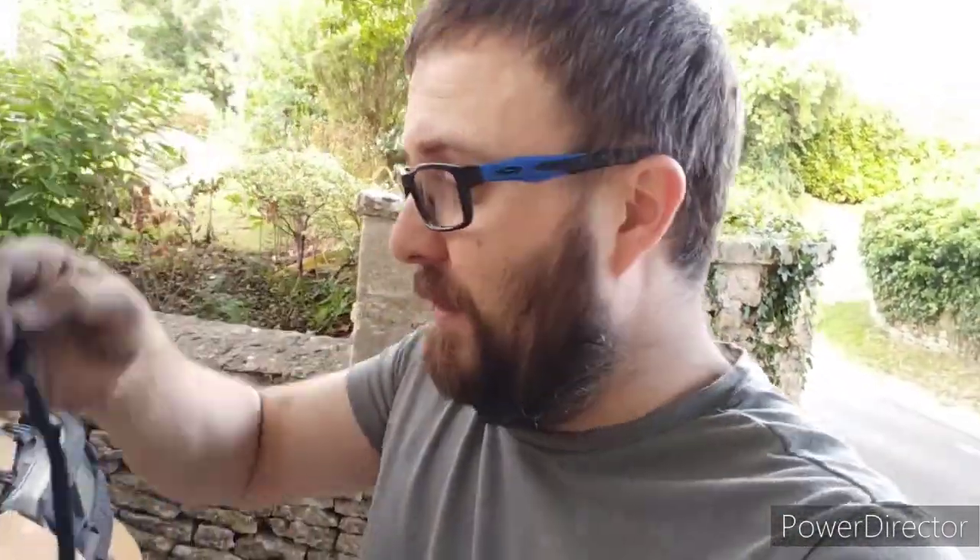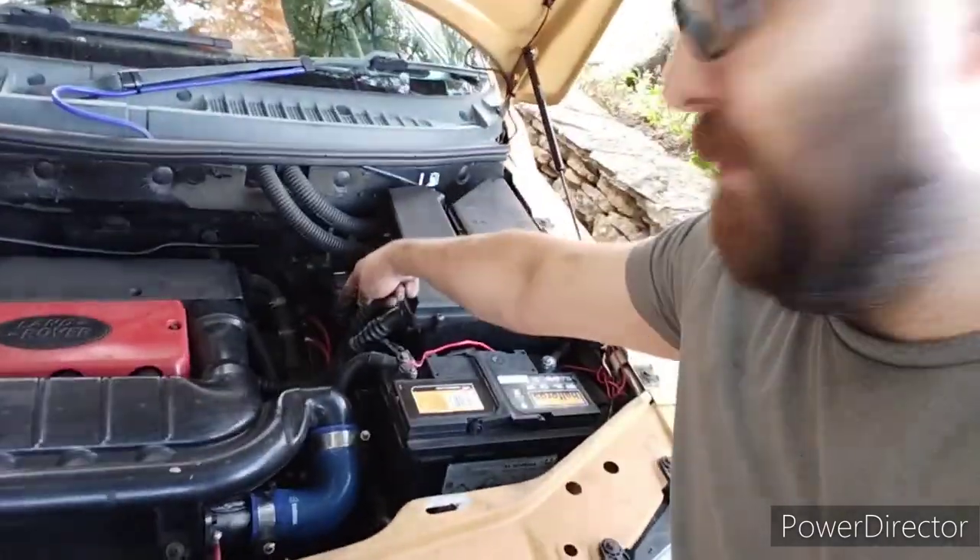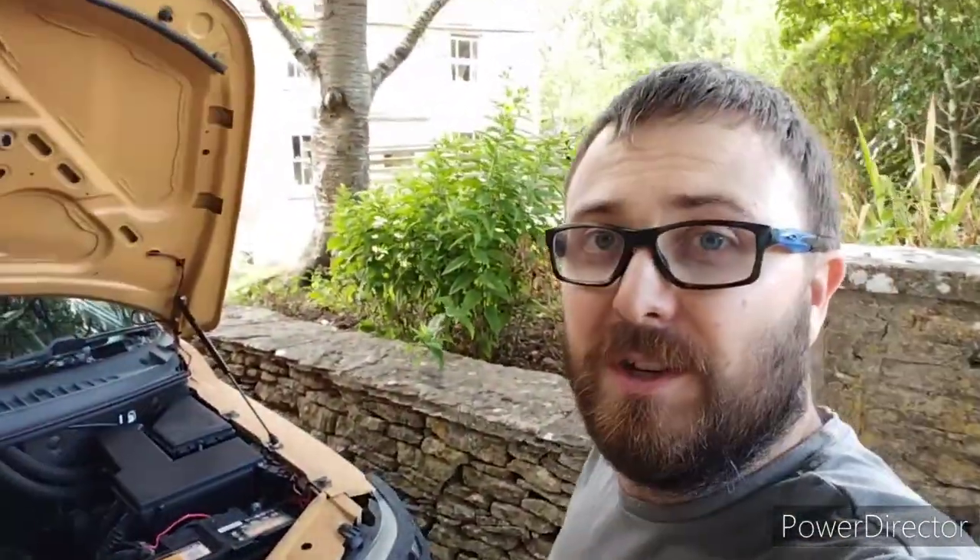When you check all these hoses, it's definitely worthwhile doing every now and again. If you've got that slight lack in power, slightly jumpy idle, and brakes going hard a little bit - look for that on all those pipes. Check those ones I've done - it's only four pipes and they're super easy to fit, they're just push fit. So EGR, turbo vent, and then the two coming off the braking system. Check those and hopefully that's going to fix your issue.